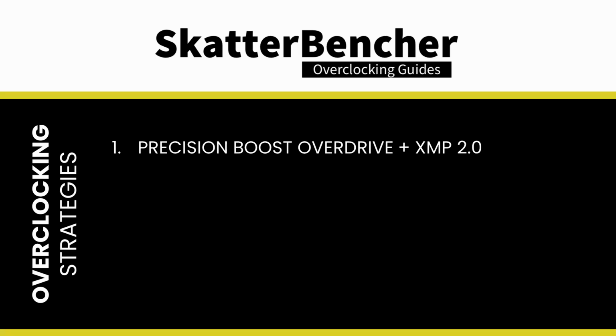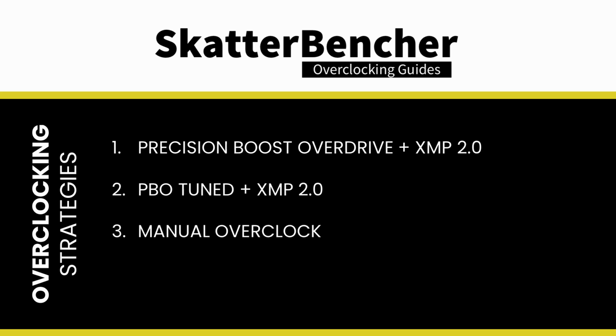In this video, we'll be covering 4 overclocking strategies. First, we enable Precision Boost Overdrive and enable XMP. Second, we tune the Precision Boost Overdrive parameters and use Curve Optimizer. Third, we go for a manual overclock on both the CPU cores and integrated graphics. Lastly, we try to supercharge Precision Boost Overdrive for maximum performance. However, before we jump into the overclocking, let's first have a look at the hardware and the benchmarks that we'll be using in this guide.